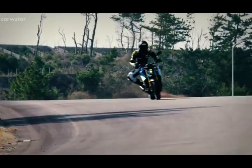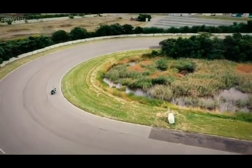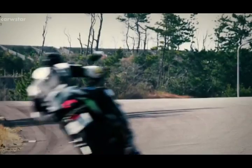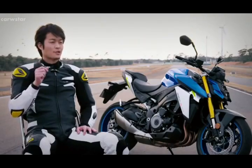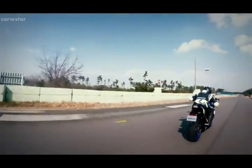With electronic throttle control, we repeated rounds of testing while reviewing the results with the engineers as we worked to match the actual power delivery to the throttle actuation and to find the best settings for each of the SDMS power modes. The tuned fuel injection system provides a feeling of solid controllability, especially under hard acceleration.